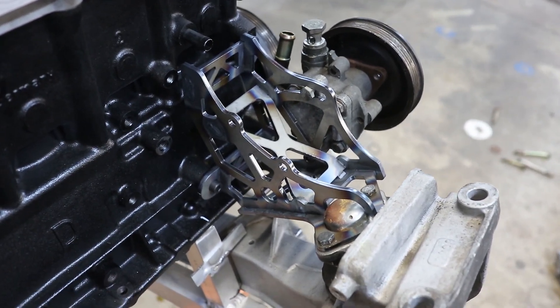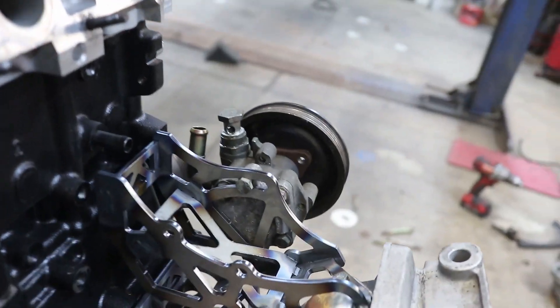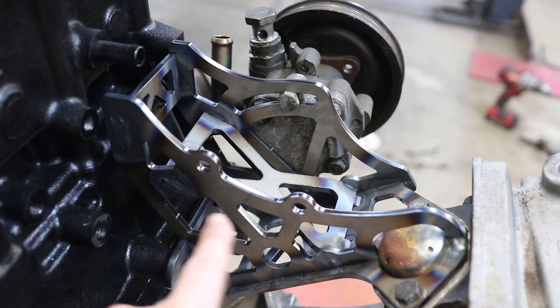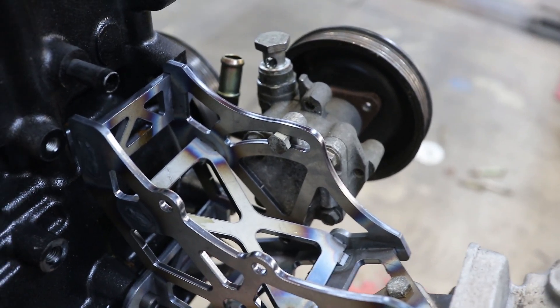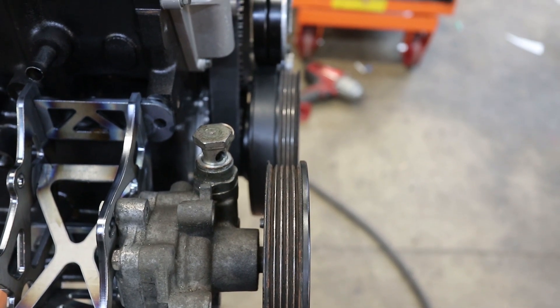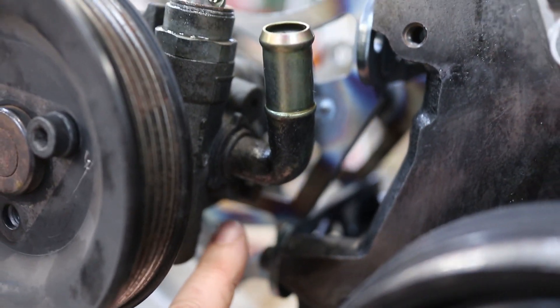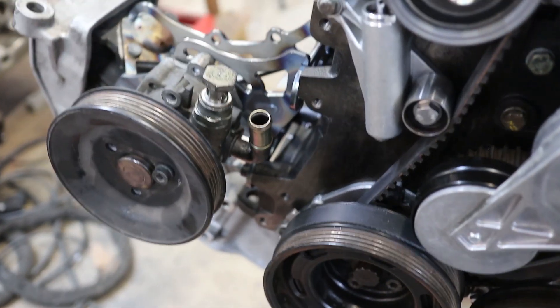I have the mounting there for the power steering pump with an access hole so you can reach the lower bolt through that hole in the back bracket. I've included some holes for a bracket to help support the turbocharger. I've got the adjustable slot for the pump in the front, and the pulley lines up just where I want it. I'm really happy with the pulley alignment. The only thing I had to do was undo a little bolt that holds the indexing for the low-pressure tube on the pump, rotate it a little bit, and bolt it back down because it's an O-ring seal.